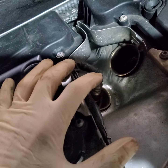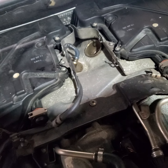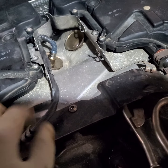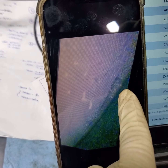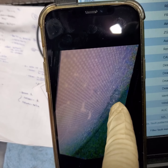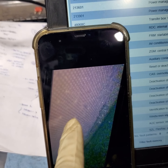That's what is causing the mixture fault. The customer had already replaced both O2 sensors — actually all four O2 sensors were replaced — and the fault kept coming back. Here's the picture I took: look at that. The honeycomb looks okay over here, but if you look at the bottom, it's all deteriorated and broken. My camera gave up before I could check the bank two converter as well, but this car definitely needs a new converter.